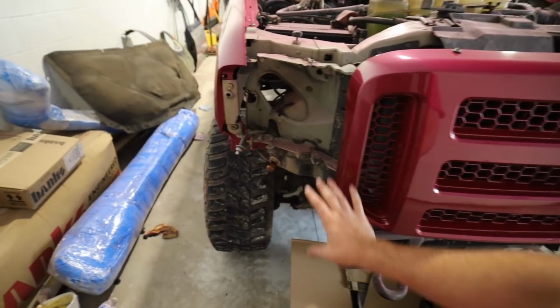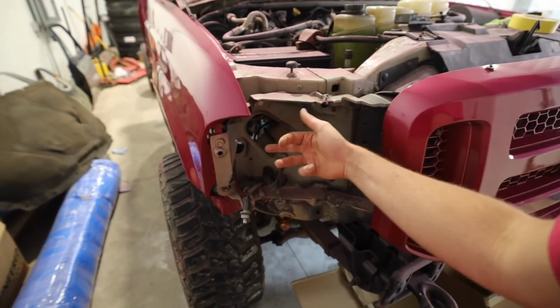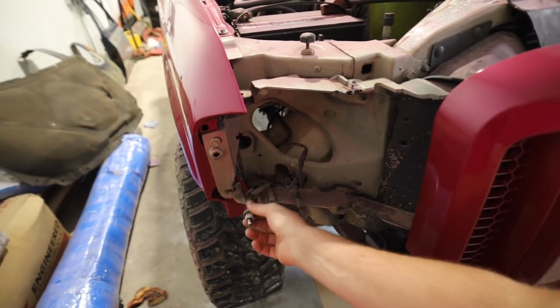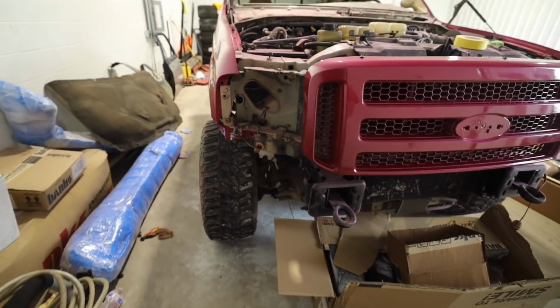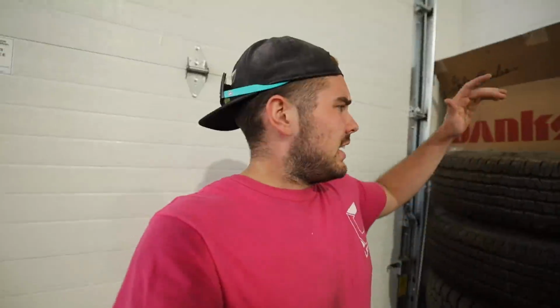I'm not sure yet. But yeah, those headlights will go in here, and then all we gotta do is run the little box so it does the switchback. I think we gotta connect it to a turn signal, which would probably be one of these wires, and then we need a constant, a switched 12 volts. So when we turn the key on, those running lights will come on with that, because I don't wanna have them come on with like the cab lights or anything, because I want them always running just like the green RAM. So when you turn the key on, those daytime running lights, really, well, the LED strip in theory, will always run.